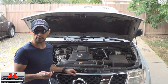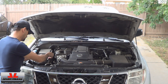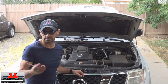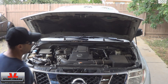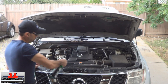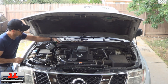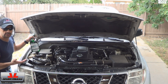First thing I'm going to do is disconnect the negative battery cable. I'm not going to cover the alternator with a bag, but it's something you can do if you want. Next step is to spray the cleaner. This is pretty mild — if it ends up getting on your paint, it's not going to discolor it like the degreaser I used in the other video, which I'm going to include a link to.